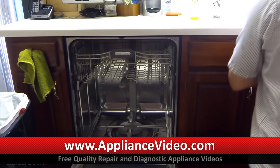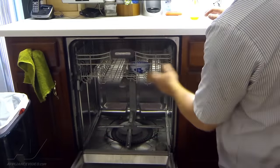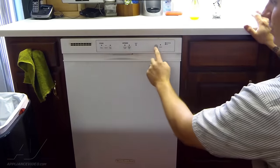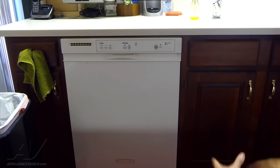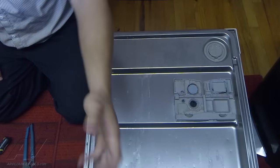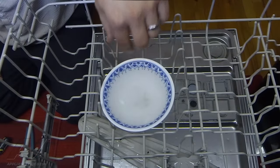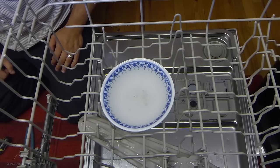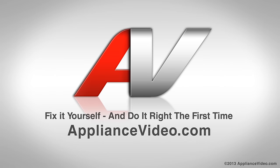We're going to put it back together. To give us an idea of whether we have it cleaner or not, we're going to take a bowl, place it into the upper rack upright. Since we can't see in the dishwasher to verify the water is moving, we'll use that. Go ahead and turn the dishwasher on, let it fill with water, let it spray for a few minutes. Then we'll open the dishwasher, look in that bowl, and make sure we're getting water all the way up to the top. Our dishwasher's been running for a few minutes — we're going to pull that top drawer out. You see our bowl we put in there — it's filled to the brim with water. So now we know we're getting sufficient water throughout the unit. We've cleared out that pump and cleared the screen so we can allow the water to flow through properly. Thank you for watching another quality in-home diagnostic video brought to you by ApplianceVideo.com.